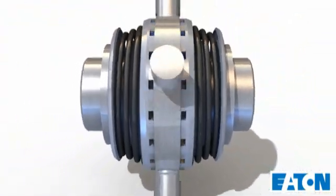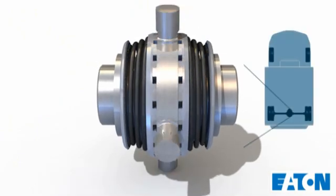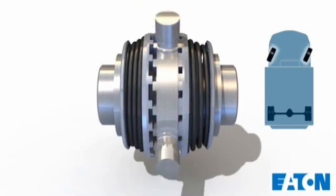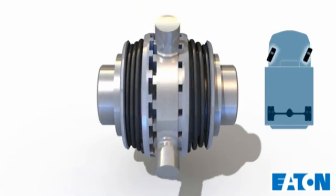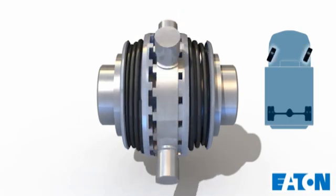When the vehicle makes a turn — in this simulation, a right turn — or passes over an obstruction, that wheel automatically rotates faster than the other for wheel speed differentiation. The faster turning wheel overruns momentarily until both wheel speeds are synchronized.